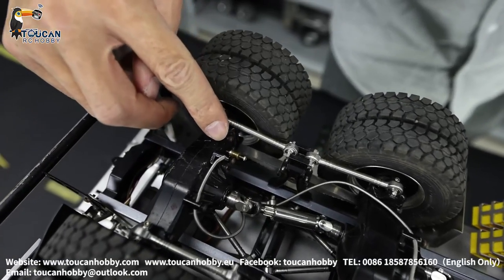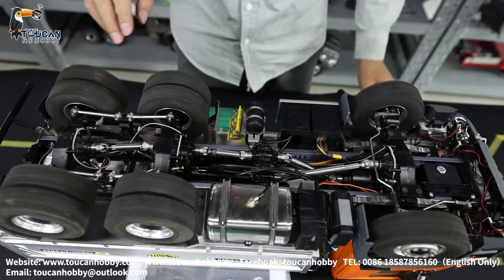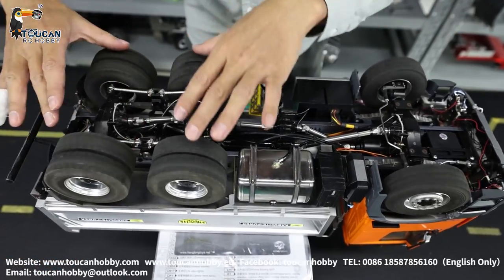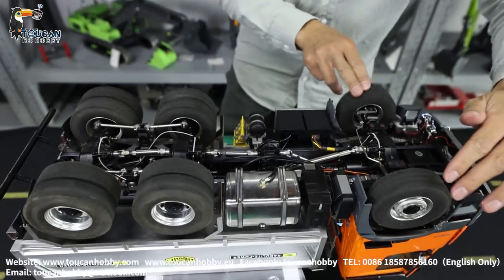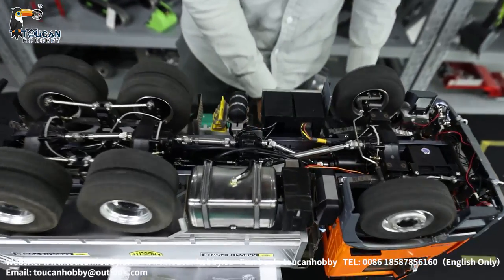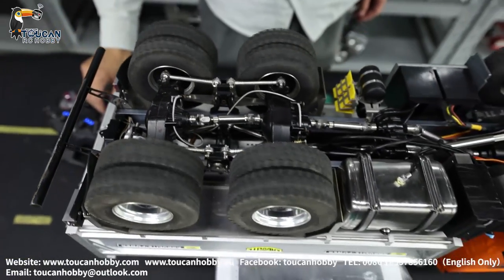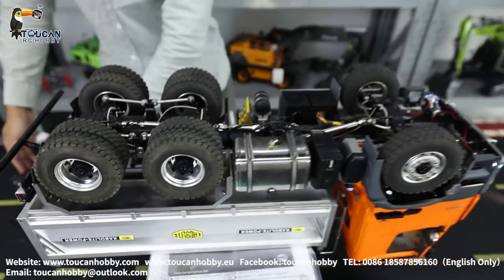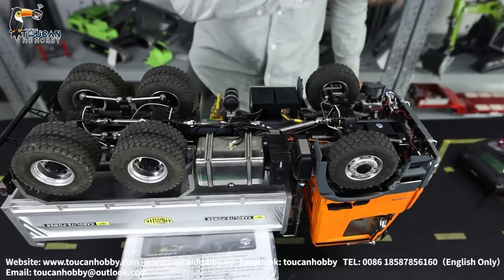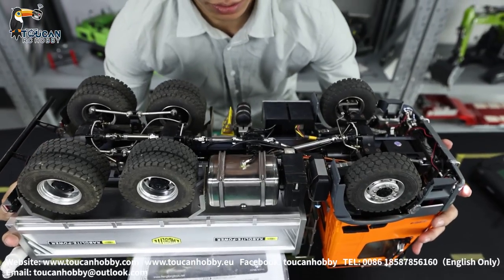Unlock, lock, let's turn it again. Stop, no, cannot stop it. It's turning together, no matter which wheel, which side. It's touching this one because lifted up too much. Also forward, it's all locked. So all the axles, all wheels turn at the same time to pass obstacles. Okay, slow down, a little brake, slow down. More slow. And the brake stop. So that's the chassis, how to change gear, and how the differential lock works. That's all for this, so we will turn it over.